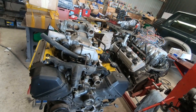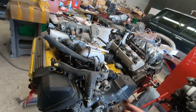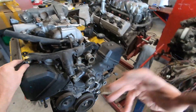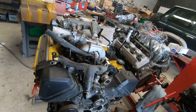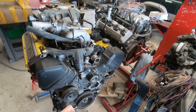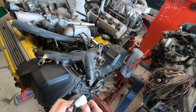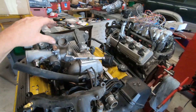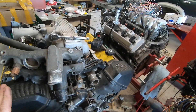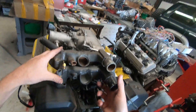Now the fan switch - the UZs run a hydraulic fan, that's for another video. You'll see this one's been blanked, they've been removed. They don't have a reliable fan switch; there's another sensor in the bottom of the radiator and another circuit - some have a different computer for the cooling system. If you want a fan circuit, I add a fan switch - this one is around about 98 degrees on and 96 degrees off, sometimes a little hotter or colder - and I normally mount that in the radiator. The housings are very similar; they interchange on both gen ones and gen twos, the only difference is the cold start injector and the bolt pattern.